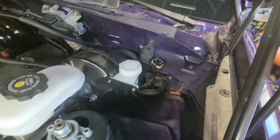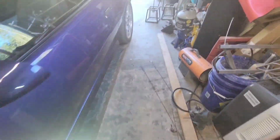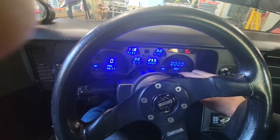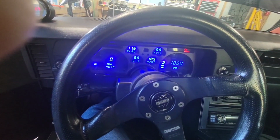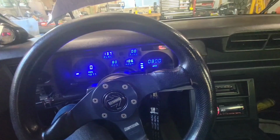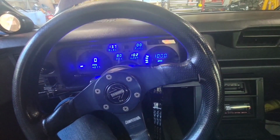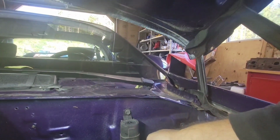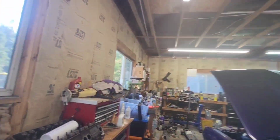All right. Relay's disconnected, oil pressure switch is hooked up. Now we'll get an extended crank. Look at that, I'm showing 0 PSI for oil pressure, now that it's hooked back up. Actually, you know what? We'll shut it down first. You guys heard the extended crank. That's how long it took for the oil pressure switch to see pressure and to close the switch.